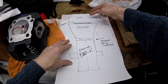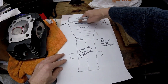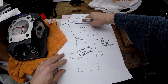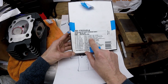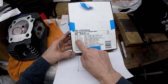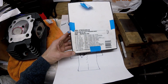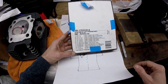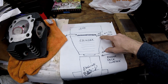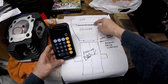On this engine the piston sticks out five thousandths. The head gasket goes between the cylinder and the head, and you need the piston to be 30 to 40 thousandths away from that area. In this James gasket set, the head gasket is 45 thousandths thick — I already know that's too much. The base gasket, part number JGI-16777-94, is a 20 thousandths squish base gasket. So I have a 20 thousandths thick base gasket after crush, and the piston sticks out five thousandths.